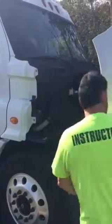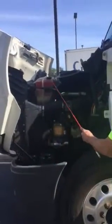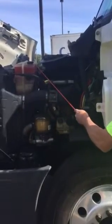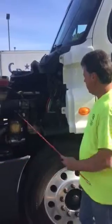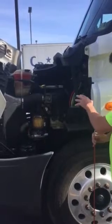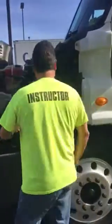Now I'm going to move around to the driver's side. On the driver's side, I'm going to start at the top and work my way down. I'll start with my coolant reservoir — it's not bent, cracked, or broken, missing nuts, bolts, or screws, I see no leaks, and it has a sight glass so I can see it's filled to its proper level. If it didn't have a sight glass, I'd turn the engine off, wait for it to cool down, remove the cap, and fill it to its proper level. Then I move to my oil dipstick and fill tube — they are not bent, cracked, or broken, missing nuts, bolts, or screws, and I see no leaks. To check my oil, I'd remove the dipstick, wipe it off, reinsert it, and pull it out.